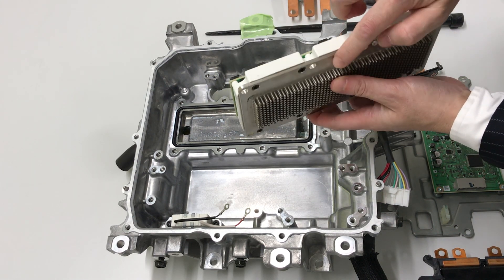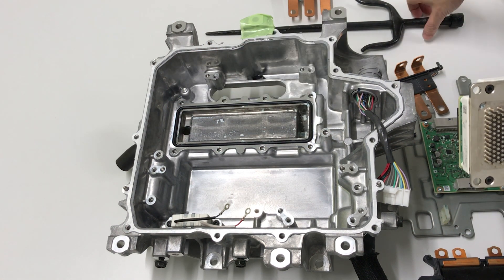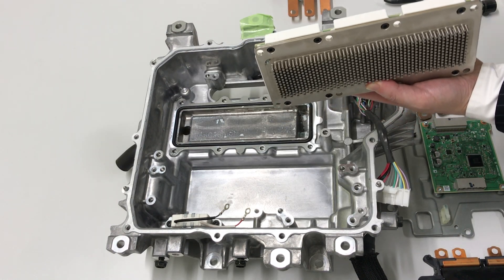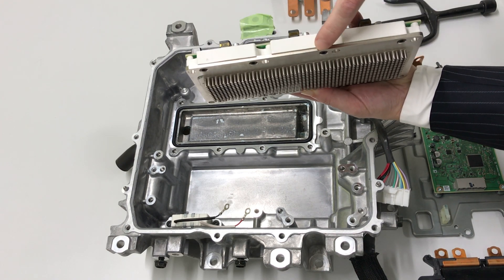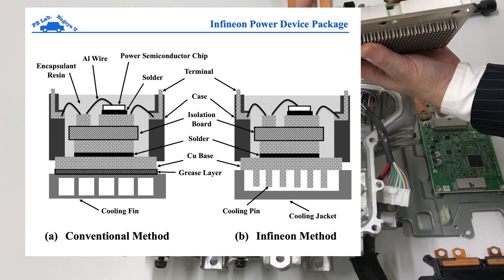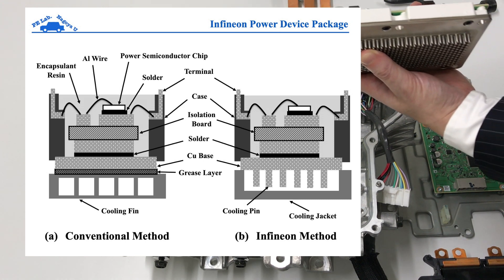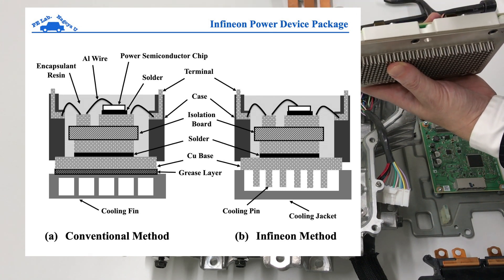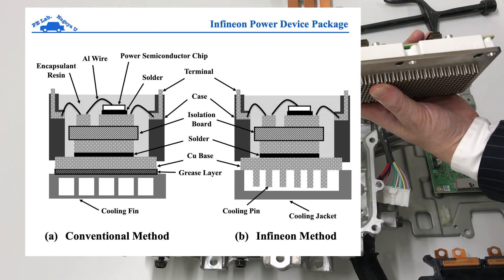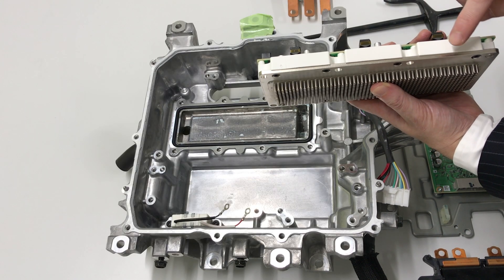The technical point here is this cooling line. The cooling line has an input side and an output side. The cooling water flows through like this, flowing between each pin. This pin has the same structure as a copper pin fin. In the case of the inverter, the IGBT chip, solder, and lower copper board connect to the lower side of this copper pin fin. The heat resistance is reduced from 7 to 5 using this design.